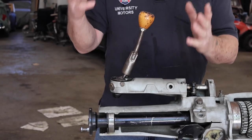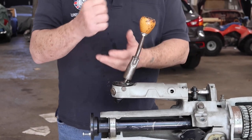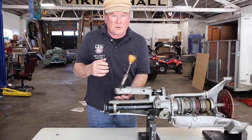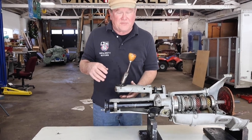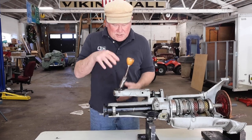If you've got the plate off and the gear lever out and you go to put it back in, put a little bit of grease on it and push on the lever. If you can get your finger up underneath here, you can guide that bushing into place — easy peasy. But you can't get your finger underneath when the gearbox is in the car because the oval plate on top won't allow your fingers to get down there; it just isn't large enough.